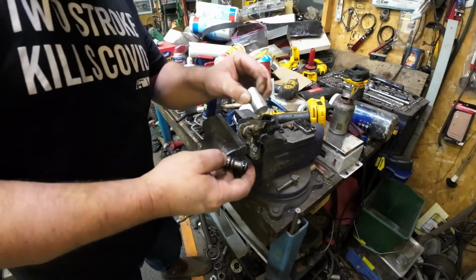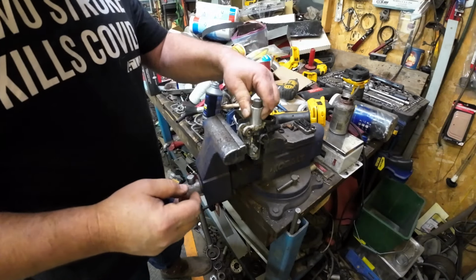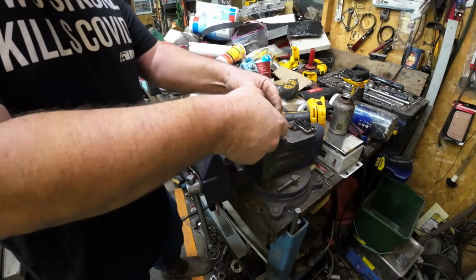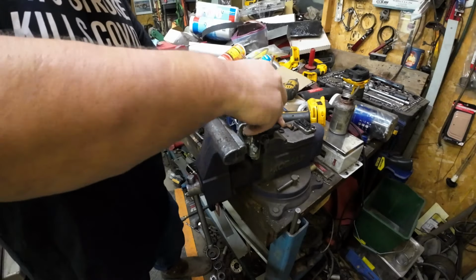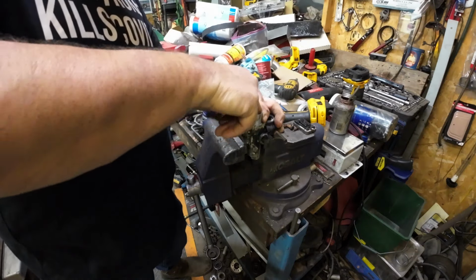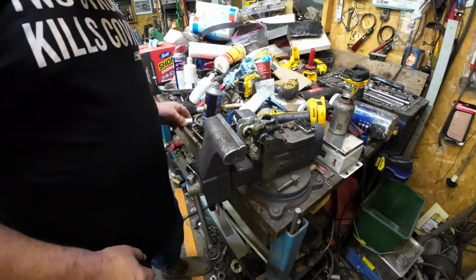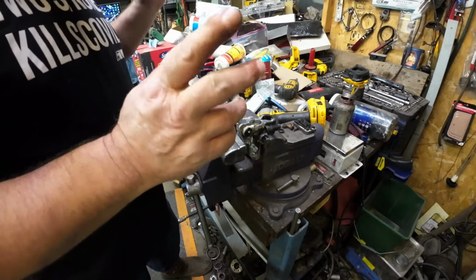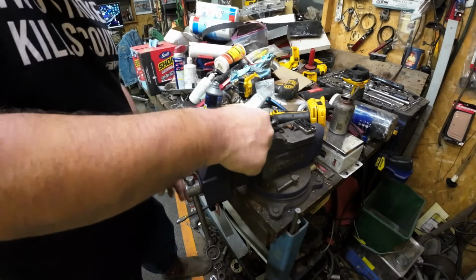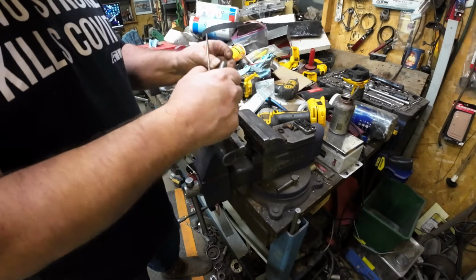And I've got my tool. Remember that from the previous videos where I rebuilt master cylinders? And the tool does pretty good. You could probably make something out of a water bottle or a beer can or whatever. But the point of the tool is just to guide that seal in. Because remember, you got the open end of that ring going in first and it's hitting a nice sharp ledge. Oh, what did I forget? I totally screwed that up. Not a big deal. Let me get this out of here. Let me knock that out again. Super easy. Just push it back through that hole.